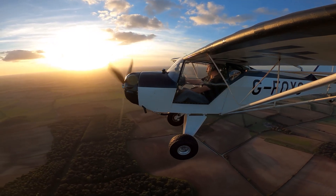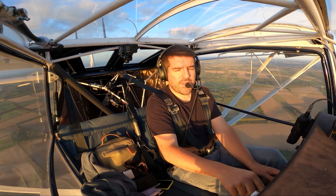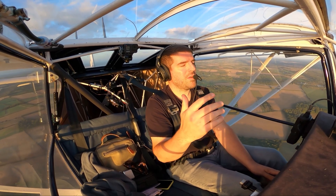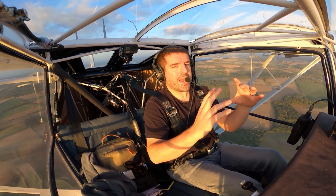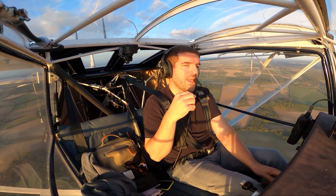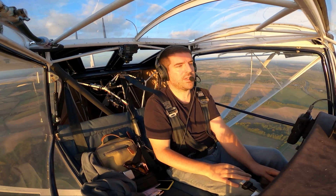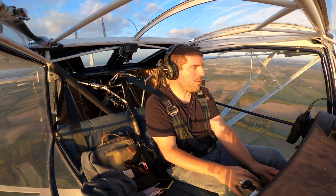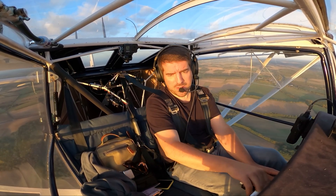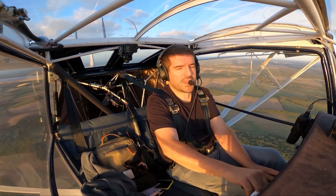Let me know if you want to see that or have any suggestions. I think I'd really like to take the prop off and do a static balance where you hang the prop and allow it to freely spin — the heaviest part settles at the bottom and then you know you can either take some weight off that side or add weight to the other side. It's a three-blade prop on this, so it'll probably make it a bit harder. It'll be a first for me. I'd love to get it dynamically balanced, but I think that's going to be quite expensive.